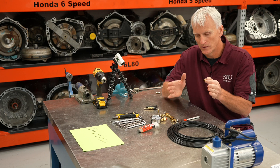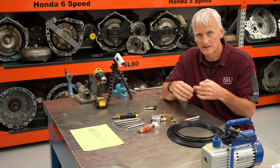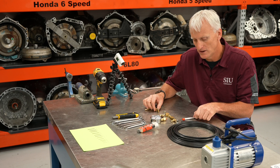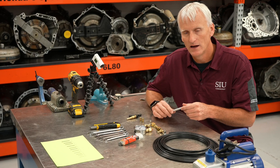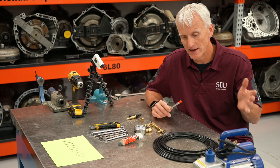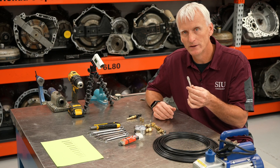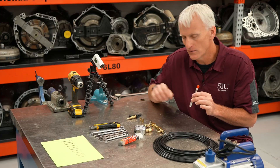The purpose is to take this vacuum pump and make it work the same as any vacuum pump, so we know a leak of a specific size creates 5 inches of vacuum and a perfect seal creates 25 inches. The standard for valve body testing is a 34 or 35 thousandths of an inch hole — and you do have a 35 thousandths drill bit in these little welding tip cleaner kits. So we take that drill bit, drill through our epoxy, and create our own little test orifice.